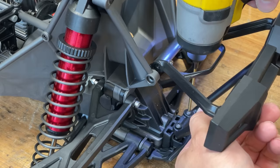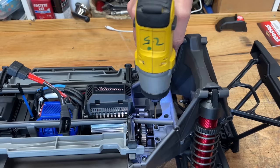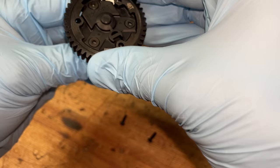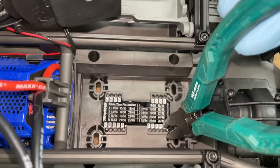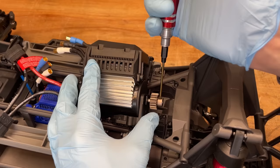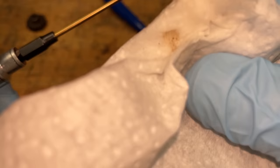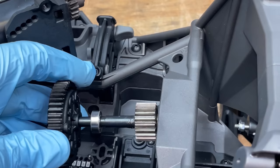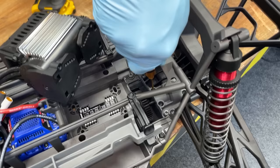Next, I'm going to get rid of these training wheels because when you're backflipping and doing other stunts, they just get in the way. In the box you also get a little rubber spacer to replace it. We're going to be running a 46 tooth spur gear and a 19 tooth pinion. A lot of people have problems with pinions coming off, so I'll get brake cleaner and clean all the thread inside and on the grub screw. Then apply super strong stud lock, and I'm also using a grub screw with a flat bottom. I'll do all the screws up only part way with the driver, then finish by hand to save the threads, and then align the pinion and do it up really tight.